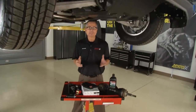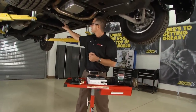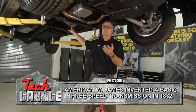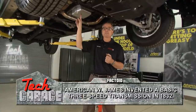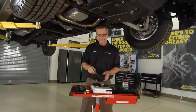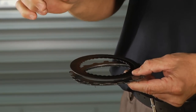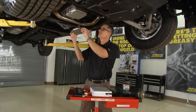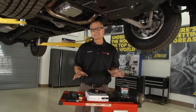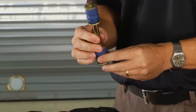We've made it to the front of the vehicle. Here is the transfer case — if it's a four-wheel drive, there's fluid in there. Then there's the transmission — every car is going to have one, and inside are clutches. The fiber wears out over time, so the fluid is going to have to be changed. There's also a filter inside the transmission that you want to go ahead and change too.